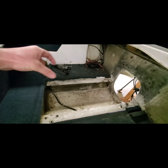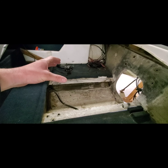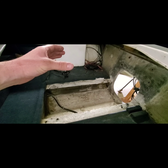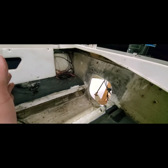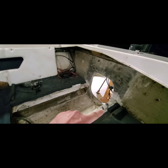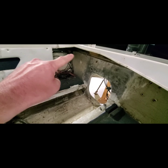The first thing I'm going to do is cut out that fiberglass there — just that little strip that goes along this way. Then I'll probably get some aluminum brackets made up for the inside. They're coming to look at it tomorrow to build some aluminum legs to go up to the plate on the back. We're going to cover that hole with either one-inch plywood — full width — going down and around, cover it, seal it off really well. That'll put a lot of strength across the existing transom.